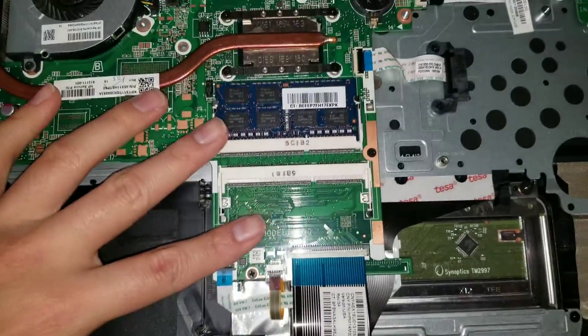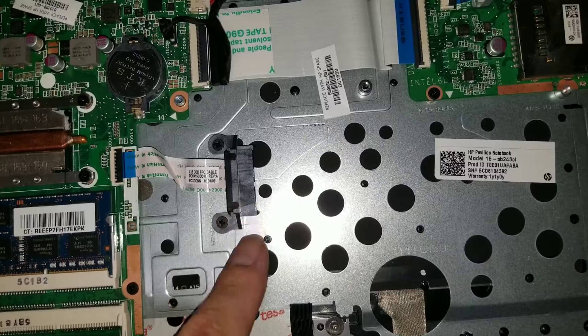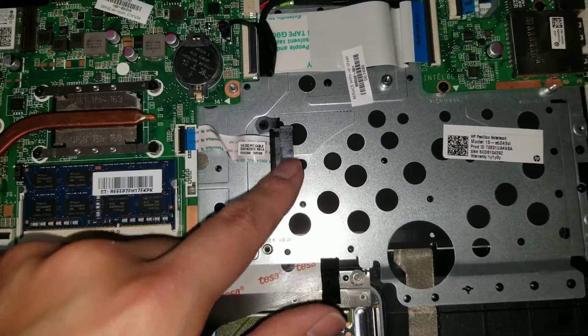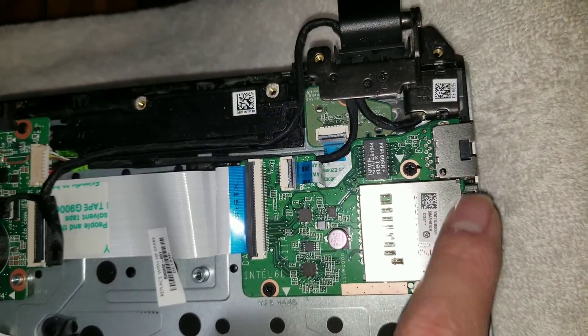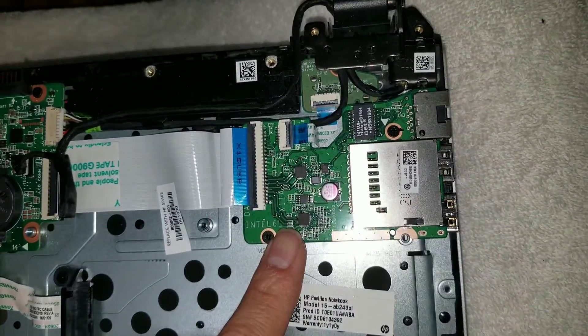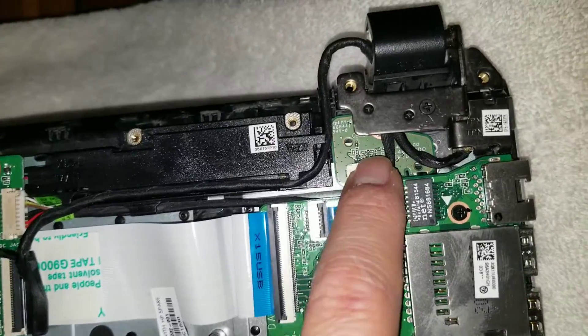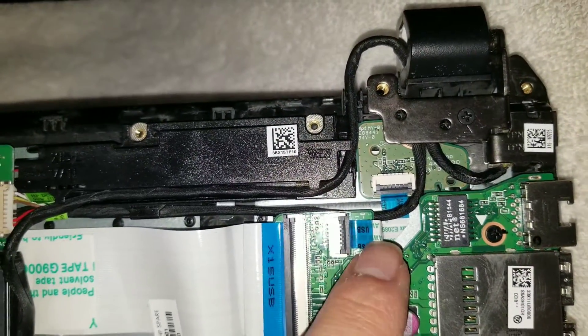You can see there are actually two RAM slots, but they only use one. There's the optical drive — if your CD drive is having issues, either your CD drive is bad or maybe the cable or connector is damaged. You can also see the LAN port, ethernet, two USBs, and the SD card slot. The power button is right here — if your power button is bad you can replace that. The charge port is under here — to replace that, you'd actually have to take the hinge screw out and flip it back, then follow the cable which plugs in here.